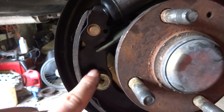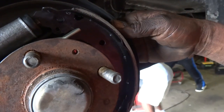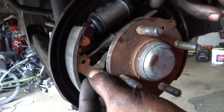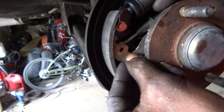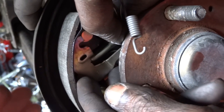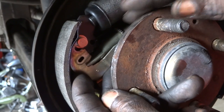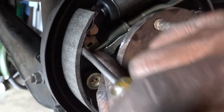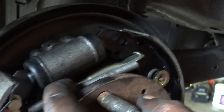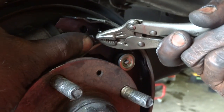They're both in the wheel cylinders. Just like we did on the left side, we're going to do the same thing over here — shove the little pin through, then put the spring and retainer washer over the top with a pair of pliers, twist it to lock it. Now we're going to put the lock adjuster on — slide it into the little tooth right here, then set it over this piece right here. It's a tight fit so get a little flat head screwdriver and pry it in there and it should lock in. Now put the spring on there and stretch it all the way to the far corner where the other spring is clipped in.